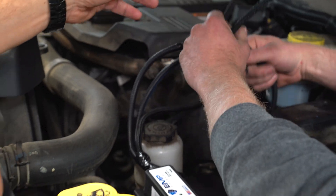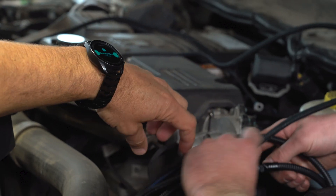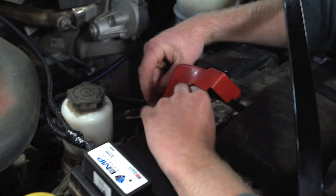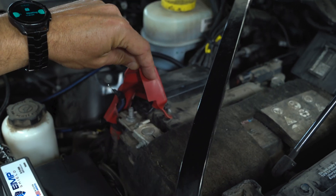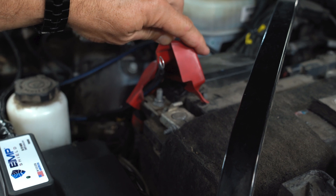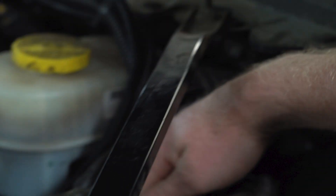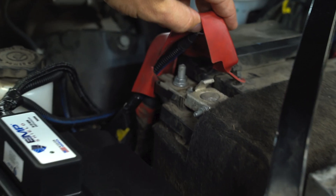As mentioned, we took and shortened up the positive and the negative. He's going to take the ground and move it out of the way, then run the wiring through the back side. We're going to attach the positive here and the negative right over there. You're going to notice we apply the negative terminal first — once you apply the negative, then we apply the positive. For those who don't know, the positive is the plus sign or the one that's red.